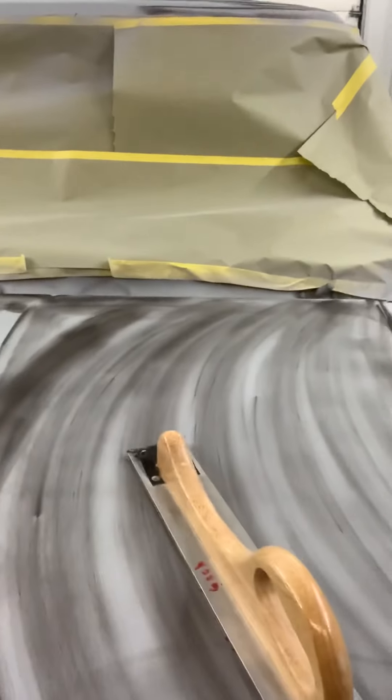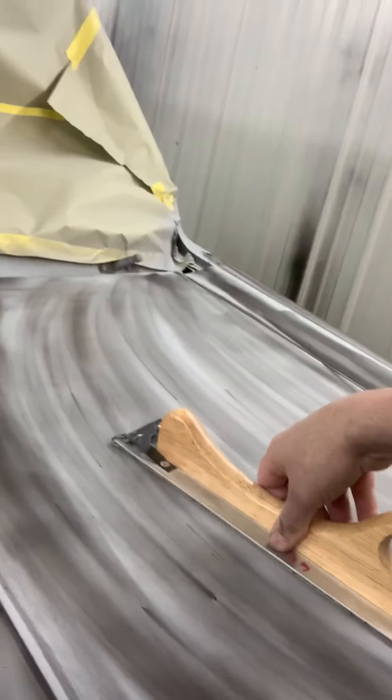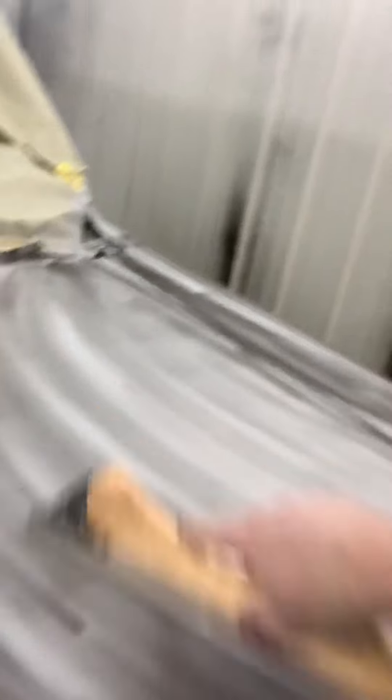I've got a whole day of dry blocking with 150 on all of this. This was taught to me by my buddy Oscar and my brother — when you're sanding on a hood like this, if you push too hard, you just start flexing and you're really not making it straight. When you're sanding a hood, you don't want to press. You just glide it along and block sand nice and easy. If you start pushing, you're just digging in. Take your time, do it by hand, nice and easy. Don't push real hard.